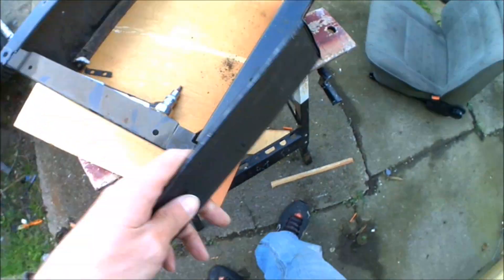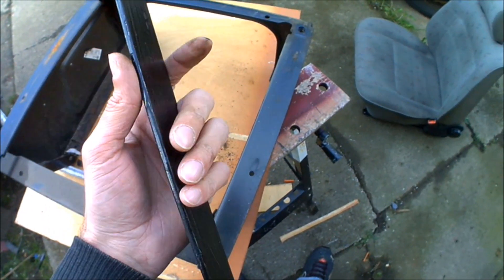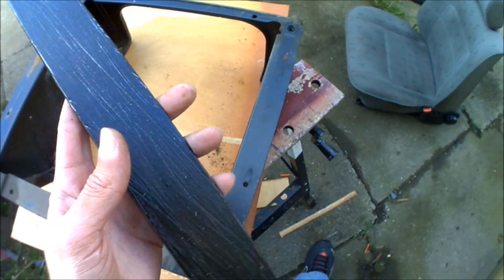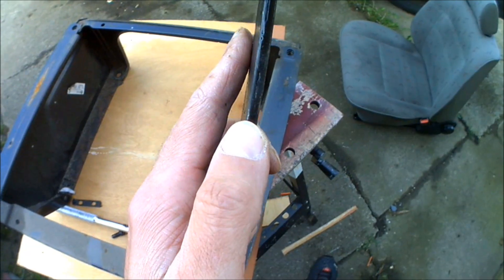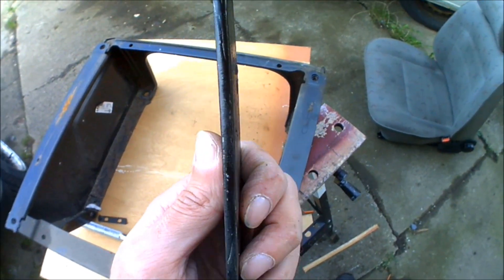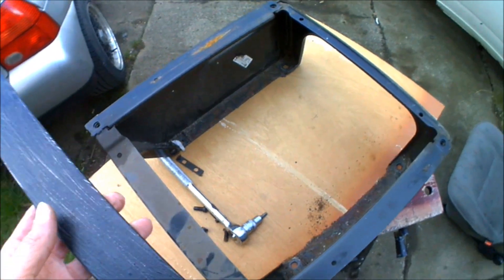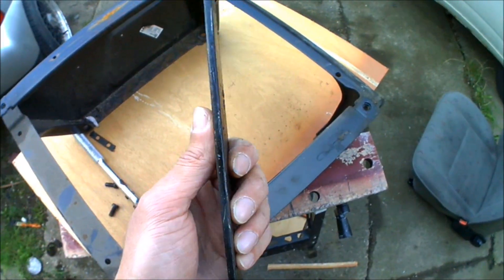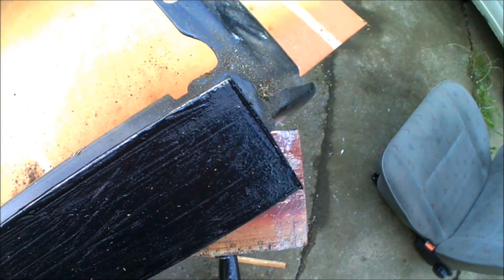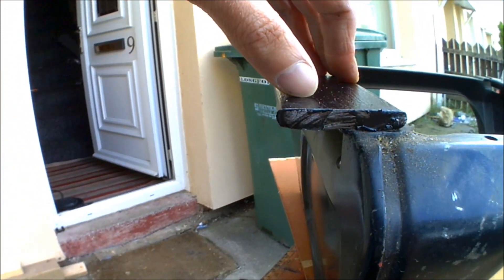Because the RX8 seats are wider than the actual T4 bases, I've been down to a steel fabrication shop and asked for some nice thick steel. They had an off-cut they sold me for £5 for 1.2m worth — it's 5cm wide and 5mm thick, so it's actually thicker than the actual base it's going onto. Obviously if you're putting any runners on, you need structural steel — you don't want light mild steel because if you're in a crash, the runner could just rip straight away from the base. That's been cut down to just over 40cm length.